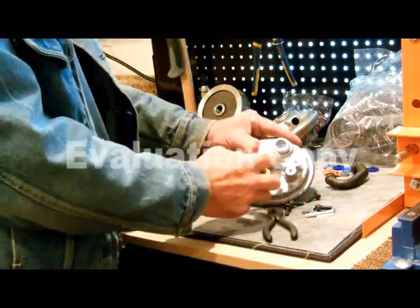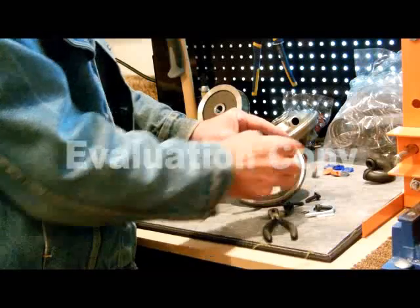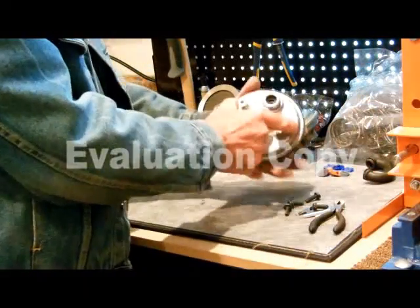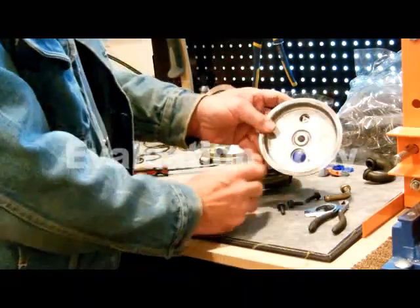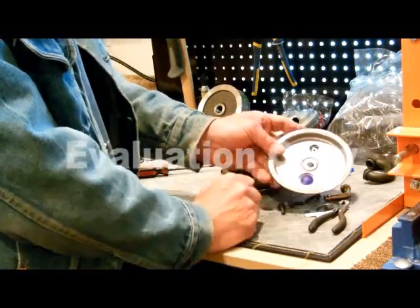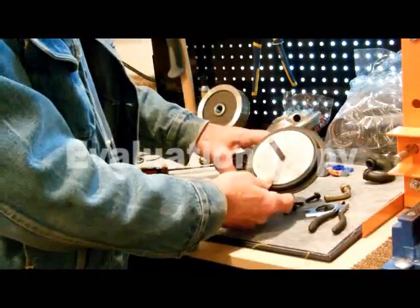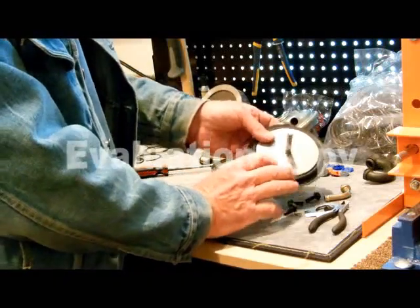Don't forget the O-ring when you put it back together. That rubber valve we showed — the one that fell out — that's what's making the racket. There's another one on the inside underneath this inlet tube. We use a small crimping tool and peel all that back, and then this comes apart. Inside the diaphragm on the bottom is another rubber disc — a check valve — and this one is usually good, but we replace it anyway. Once that's done we have new valves replaced with one new one in each side. This is the diaphragm — this is what makes the actual vacuum, and it has almost like a valve guide on the valve stem to an engine that goes down inside there.